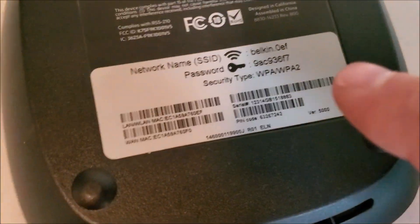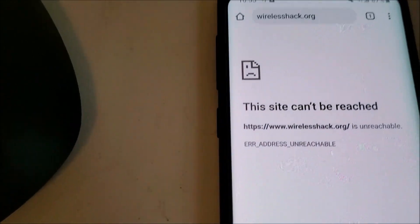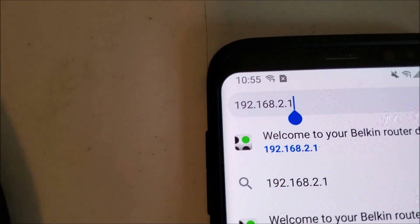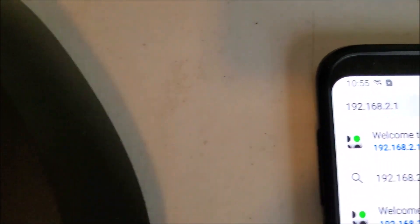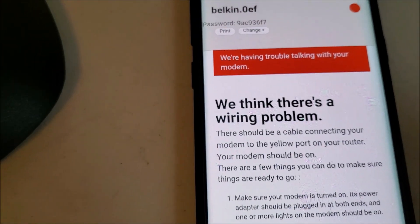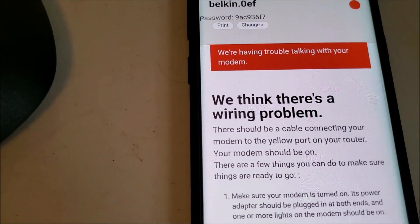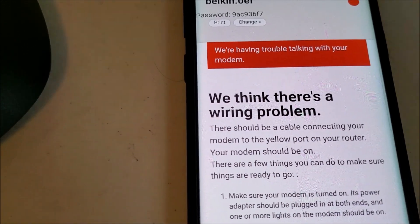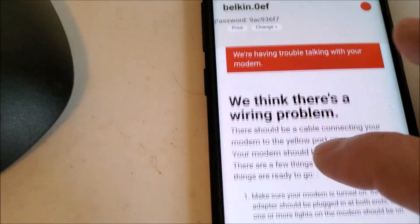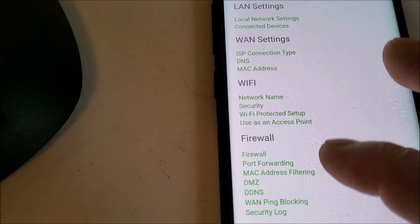Be sure to change your default Wi-Fi password. So if a browser didn't automatically open like that, you open up a browser — for Belkin, they're 192.168.2.1. So I'm going to go ahead and type that in and click go. And it automatically logged me in again. Often there's a username and password that you need to enter, which is usually default like admin/admin, or admin and then no password. Google what that is — it's really simple to find online. Just Google your router name and the model number and you should be able to log in.